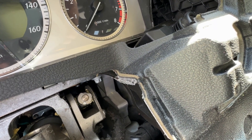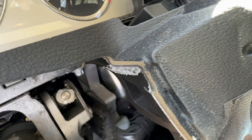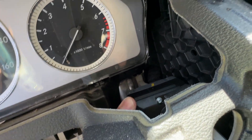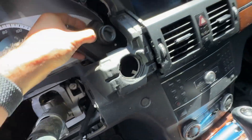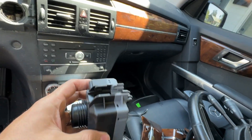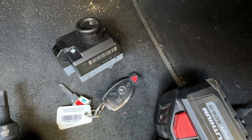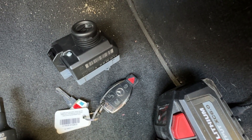I like to loosen it up with an open wrench — a ratcheting open wrench is useful here, or if you have an auto ratchet like I've got, it's even easier. So the ignition switch is through here. Once you get those two electrical connectors off and the shift cable, you can pull the switch right out. There's your switch. If you're sending an ignition switch in with your key fob for an emulator, all we need are these two parts. We don't need the lock — don't send the lock. You do need to get it out of your column if it's in the locked position. You can leave it in if it's working and in the unlocked position.